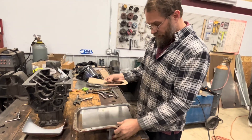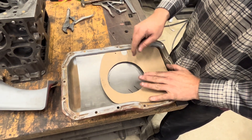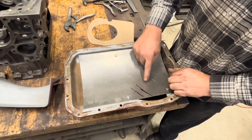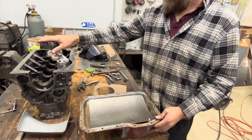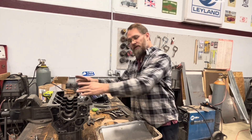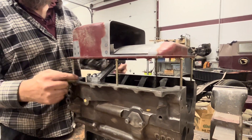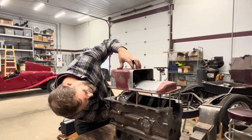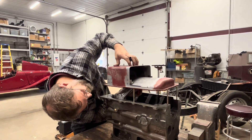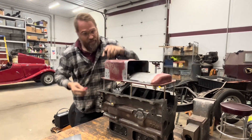What I've got to do here is I've already marked this by using this template here from the special tuning — I marked out where the original hole was, which gave me an idea of where to start cutting. I've got to start trimming this out and offering it up until it fits around this without being too big of a hole. What we decided to do is take the longest quarter-inch bolts I had, put six of them around here, set this on top, and it's lining up pretty well. So I can go up underneath here with the marker and mark out exactly where this thing is at, and then we can start cutting from there.